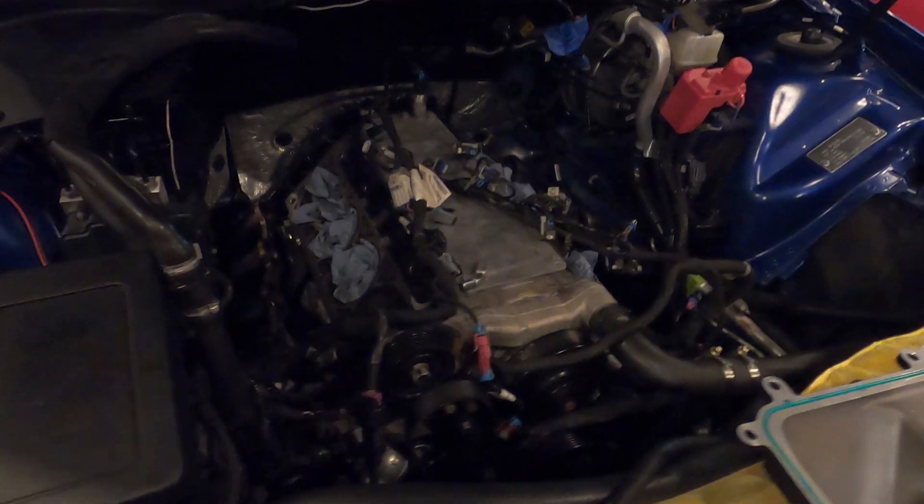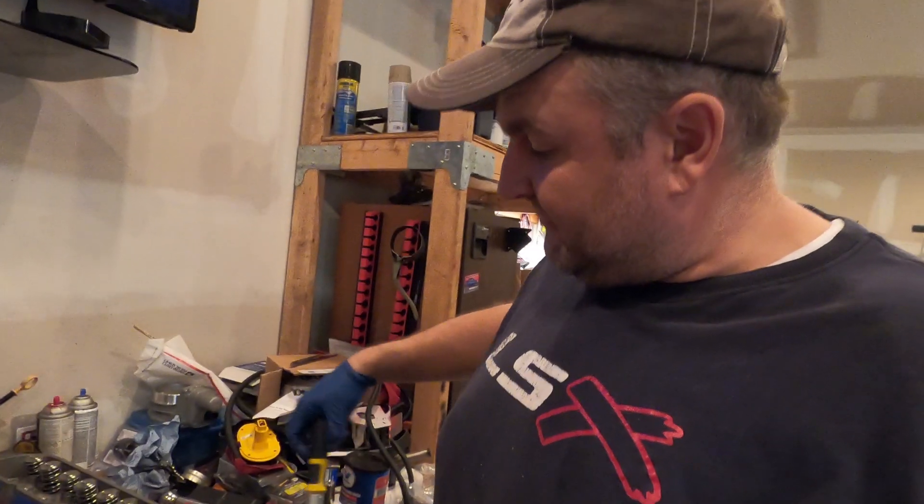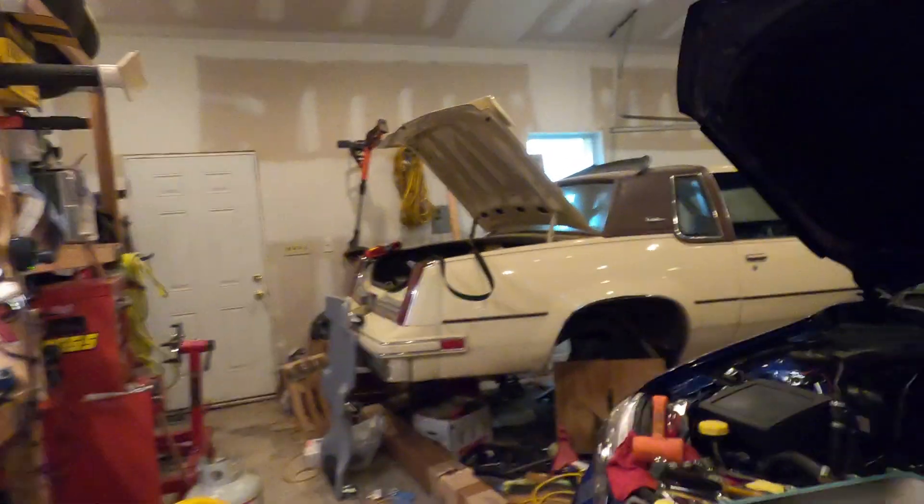Both sides are off. I'll admit the passenger side was a bit harder - the issue was the back of the head. You can see it's a little scratched up because of this clip that holds the wiring harness. What I ended up doing was using an oscillating saw that you can get at Home Depot. From the front of the car, I directed it with my fingers off the firewall at an angle - that was the only way I could get in there carefully without marring the harness. Everything's off now and the fun cleaning game begins.